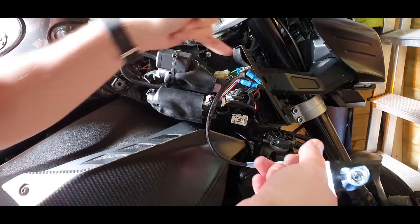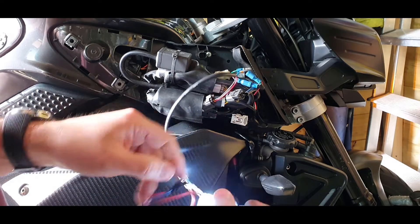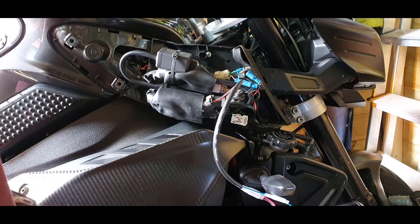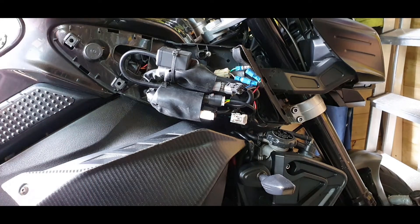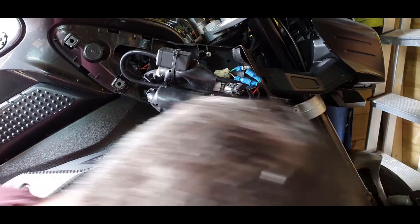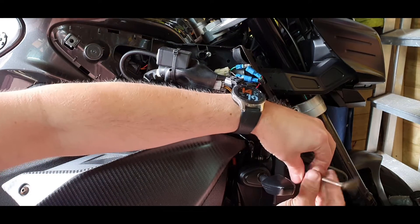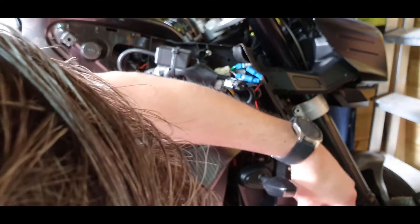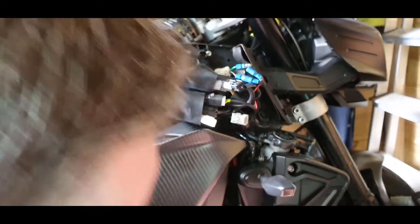I'll board something up because I've already cut into it. What you will do is fit it first and we'll go through that now. What we'll do is remove the indicator - I'm going to roll this kind of live. This is just the panel that's bolted into the radiator. When doing these back up be mindful not to overdo it - I've stripped the thread on the inside before. The rad is only aluminium. It's a 5mm allen key.